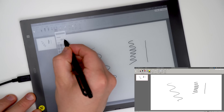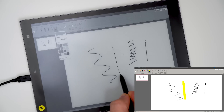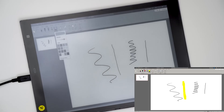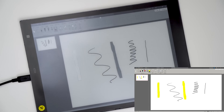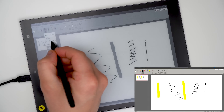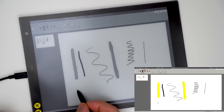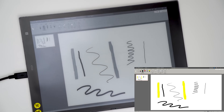I can show this more easily by selecting the highlighter in PowerPoint. When I move the stylus you can see that in PowerPoint it's correctly drawing as a highlighter, but on the e-ink display it's being drawn as a black line. It's not until I lift the stylus off the screen that the display updates to reflect what's actually been drawn. There are controls to configure what size pen is drawn by direct handwrite, and further development could edit the driving software to automatically change the direct handwrite update size to reflect the pen chosen in PowerPoint. The only thing we couldn't do is draw a greyscale line since partial updates can't be performed on shades of grey, and ghosting from the direct handwrite's black line would be a visible issue. This is a niche example but it shows how far we've come with e-ink technology.